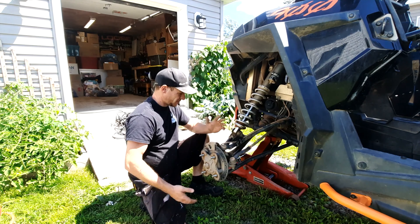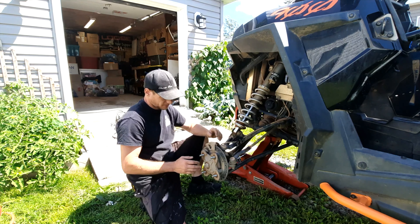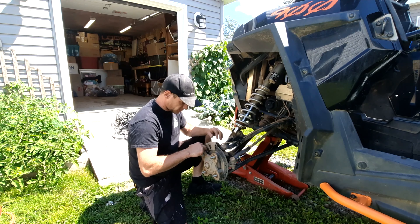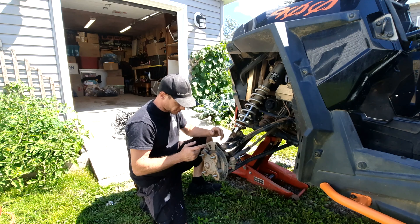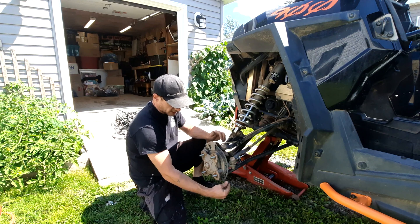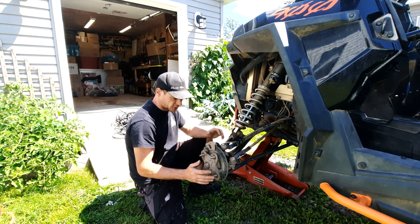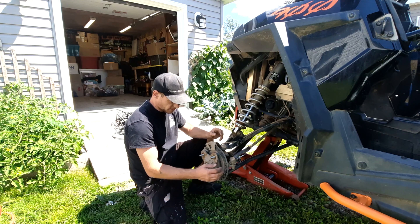But are you really saving? I've tried those cheap pads and got maybe four or five rides out of them — they didn't last very long before I had to change them out again. When you take into consideration the time it takes to change pads plus what they cost, and if you have to change them three times as often as OEM, you're really not saving money. A good alternative I've personally found that lasts a decent amount of time are EBC Brakes — specifically the EBC Severe Duties I had on the front of my RZR 800. They didn't last quite as long as OEM but they held up pretty good.